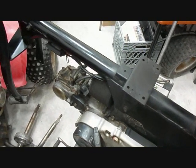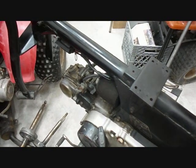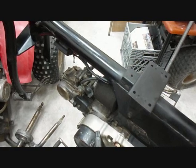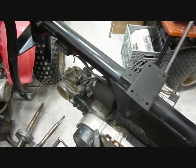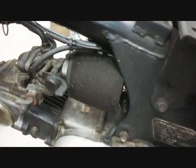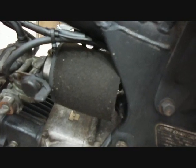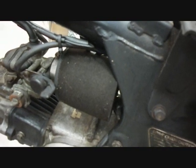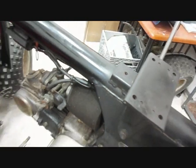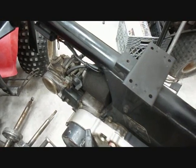So what I'll do is check for spark first. If there's no spark I'll have to chase that down. I have another couple alternators — or stators I guess they're called — and another coil, and probably all the parts for the points. Even though it's been through fire and smoke, it has a filter on it so I don't think anything got inside the carburetor. I'll pull the filter off and shoot some starting fluid in and see if it'll run. It feels like it's got compression.